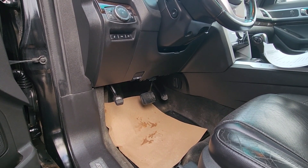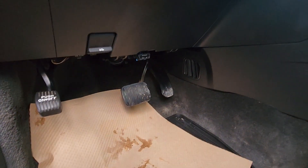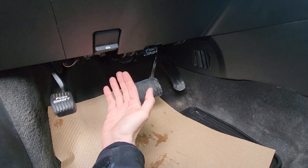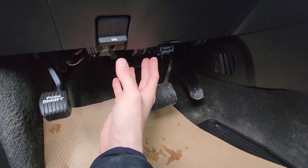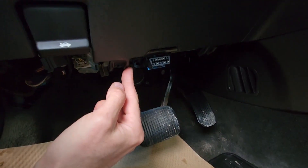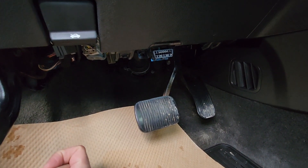Accessing those fuses is not the easiest — you'll have to get your body into quite an awkward position. The fuse box will be just under the steering wheel in the upper left corner. My Explorer is missing a cover here but you will have a plastic cover. To remove it, just remove these two screws, one here and one on the opposite side, and pull the cover off. Once you do that you'll have full access to the fuse box.